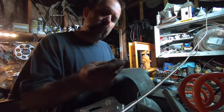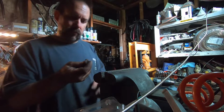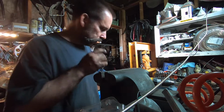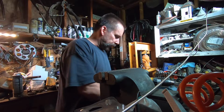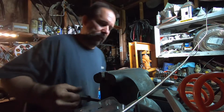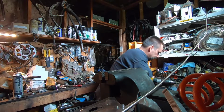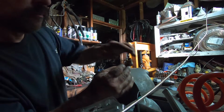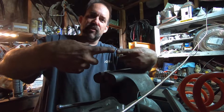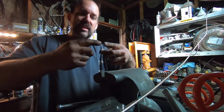Yeah, some people might frown on reusing parts like this, but the way I look at it is, would I take my wife and people I love in the car down the highway at 75 miles an hour with this? Yes, absolutely. Without question. I wouldn't worry. Reason for that is because when I was a teenager, I did everything you're not supposed to do regarding brake lines. I made them out of, yeah, I'll show you. I still have some. I used to make brake lines out of plumbing fittings like this. Brass. And it's completely hollow inside. So what you would do is get both lines to smash into each other and hope every once in a while you could get them lined up perfectly and crank those nuts down tight and they wouldn't leak a drop.